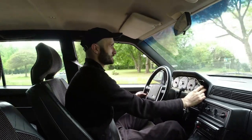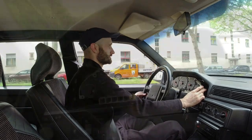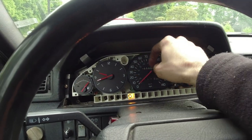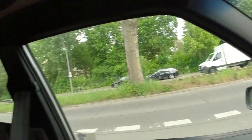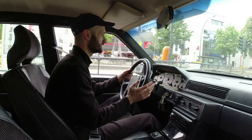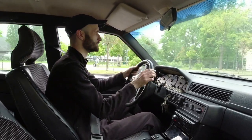So the phone says 40 kilometres, and this says 50 - it's too far off. So I've gone up against the stop, lifted it up over, and put it just over the stop. I've actually turned the spring that way over the stop, so now there's a better spring down to zero. Comparing it to my phone, I think it's about 5 off now - so it's 50 here and 45 there. That's where I want it - that's good enough, because I don't want to be speeding. I'd rather read a bit too high.